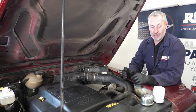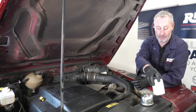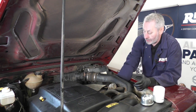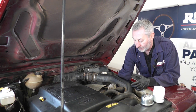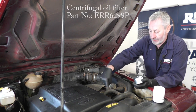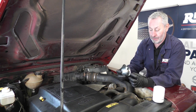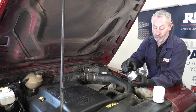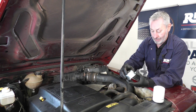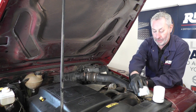I'm now going to change the oil and filters. There are two oil filters on a TD5: there's a conventional spin-on one, located just underneath the turbo — a little bit difficult to get to, but it is gettable. And then there's the centrifugal filter, which fits in a housing just down here. These are really good — if you've ever cut one open once they've been used, the amount of muck in there is unbelievable how much they collect. They're a really good idea.